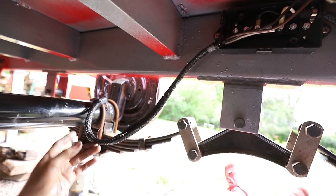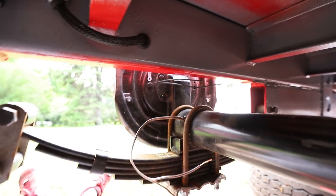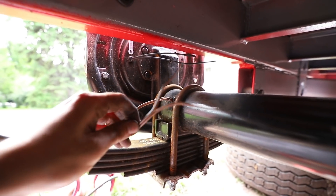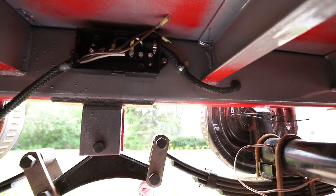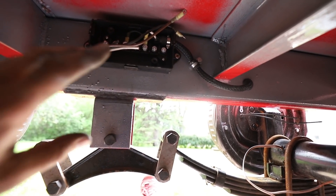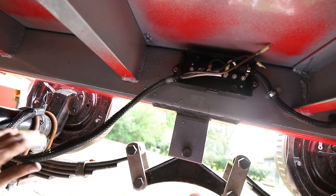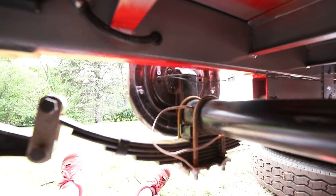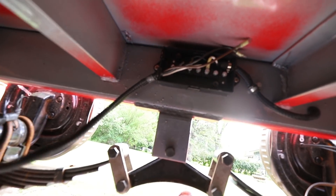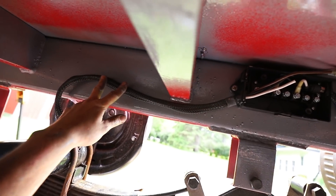So this is the after, and this is the before. What I'm doing is creating essentially a little wiring harness here, which brings the leads from the transverse line that goes through the axle as well as the brake right here. On this side, I have this line which goes through the axle over to the passenger side brake, and this is the line coming out of the brake. Both of those come back into the junction box and tie in there. Normally on other installations, you don't have a nice junction box — you have a whole bunch of splices out in the open, which I'm trying to avoid. So the little wiring harness makes it pretty nice. I'm gonna do the same thing over here — all four of those have to be extended, and I'll make it look clean with some jacket and figure out some kind of clamp or clip to get these stuck up nicely in here.